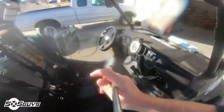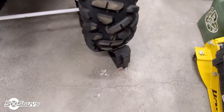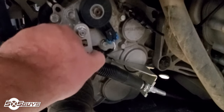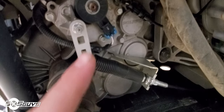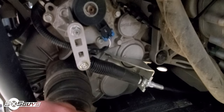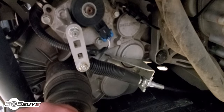When we were on the dunes we manually had to do the shifting by hand, and that seemed to work when we had a two-person team. But when you try to do it by yourself, the shifter up front won't engage all the way. So we've got to take apart the plastic from the shifter, take a look at the cable, and see what's going on — because I don't think there's anything wrong back at the transmission.